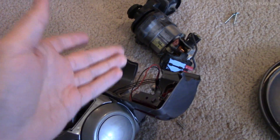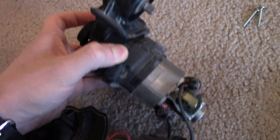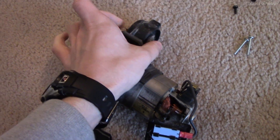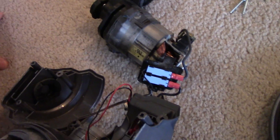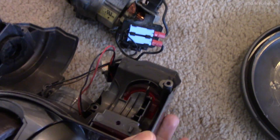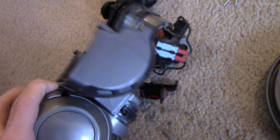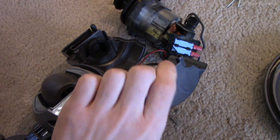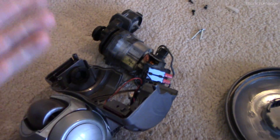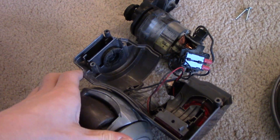What I expected to find in here was a little circuit board which controlled the motor. This is the motor here — just your standard universal motor with a gearbox, and the actual brushes attach one on either side. I expected to find a circuit board or some sort of circuit breaker, because there's a momentary power button on these power heads that turns the thing on and off. And if you stall out the motor, it will also automatically shut itself down, and then you can press the button and it restarts. So there's clearly some sort of intelligent logic surrounding this, and I expected to find a board with that logic inside the power head. But I didn't find anything — that's what led me to take apart the actual vacuum cleaner itself, because the brains are actually in the vacuum.